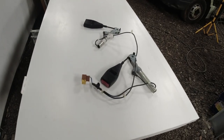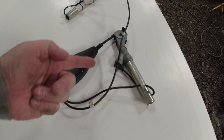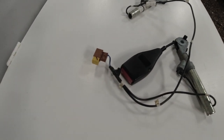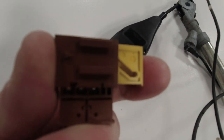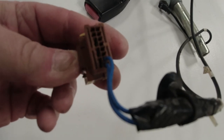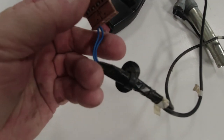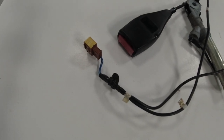I'm going to show you the actual pretensioner and how it's wired into the seat belt plug, just to give you a description so you know what you're looking for. That's what your seat belt plugs into. I'll remove this whole mechanism from the underside of the seat — and there's the plug explained earlier, with the slant in it, so as you push the plug in it locks. You can see two wires going into that plug, and I match the pins inside the plug up with the pins on the socket in the van — that's exactly how I know where to put the resistor.